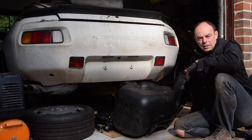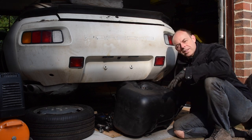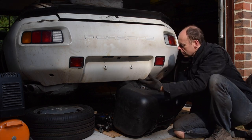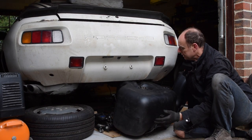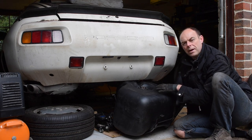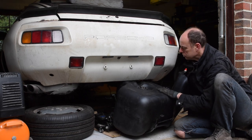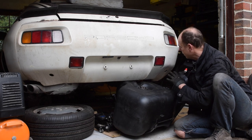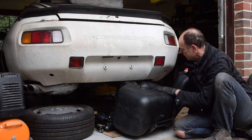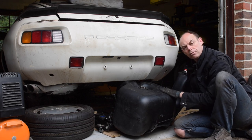Let's jump in and see how we get on. Today's task is another one of the lying-under-the-car jobs, but it's the final one I think — it's the fuel tank. I'm going to be gently offering it up using the trolley jack to sort of lift it. There are a couple of pipes I need to attach and I'm not sure about the access, so I'm going to lift it up gently and have a look. Ultimately I'm trying to get those four bolts in just so it's suspended on its own, and there are a few cushioning pads I may need to slide around to make sure they're in the right location.